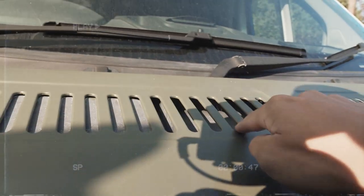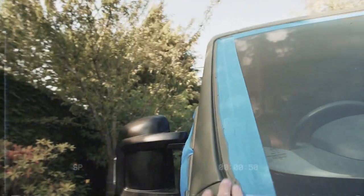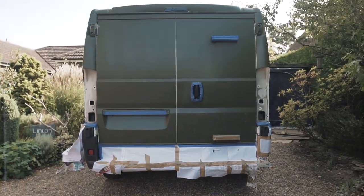All the little details I was talking about — rolling onto the bonnet and going around with a brush doing all the little details up the side of the van by the windscreen, around the windows, around the door handles, and the seals in the middle. The roller doesn't actually touch that, so I had to get a fine brush, go along the seal, then roll over the top just to put the texture back in. At the back I still need to do inside the door shuts, but yeah, it's not looking too bad.